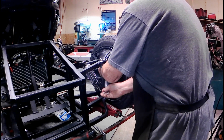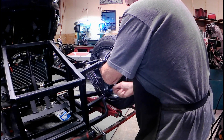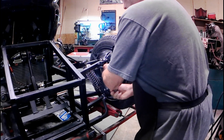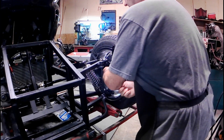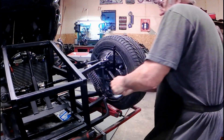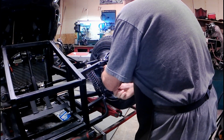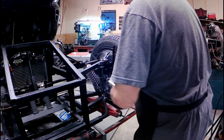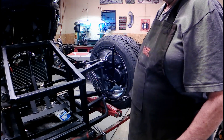Let's get these guys tightened up real good. I came in yesterday and did these and got them powder coated, so they're ready for the final step. This is all I've got left on this until my painter comes back. If you're wondering how much torque you put on these, it's as much as you can possibly pull a wrench — which is about, oh, probably 180 foot-pounds. They will not be coming loose, I'll tell you that.